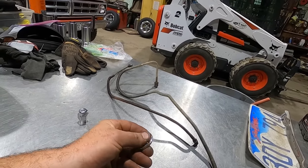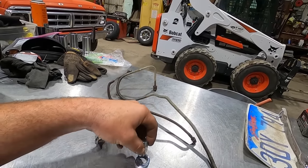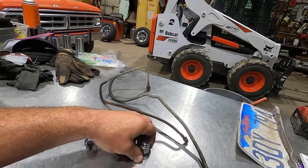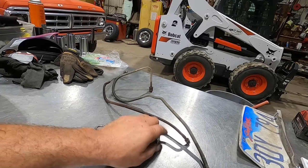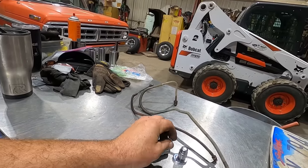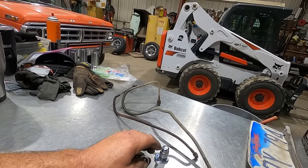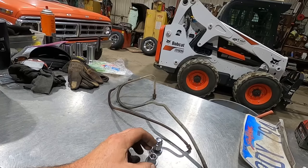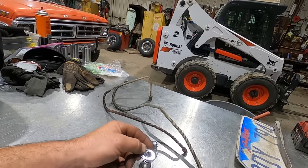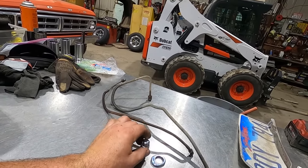They're flat on the backside, and then they got a taper in there. So you use a lug nut like this. It's got a little bit of a shank, and then it's also got a taper on it. The reason you gotta have that shank on there is so that you get enough thread engagement. And this is what we took off. It's got that long shank and then that flat washer. I thought I could use these lug nuts, but the diameter is too large, so those don't work. So make sure you're using the right lug nuts, the right washers.